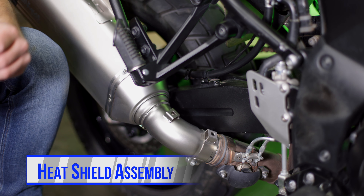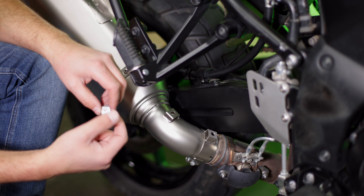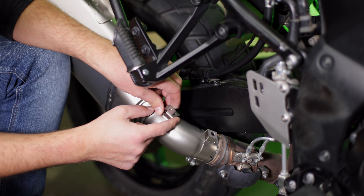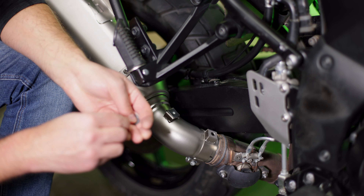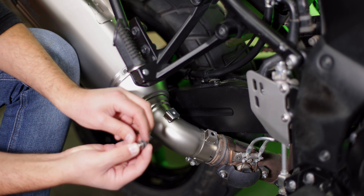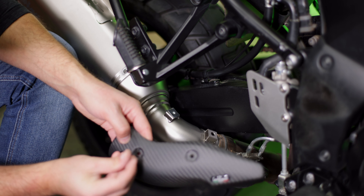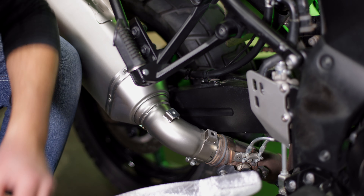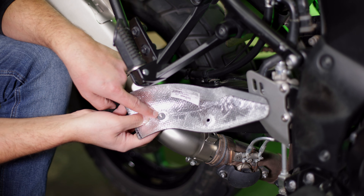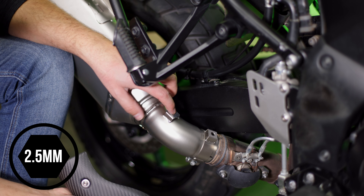If you're watching this and you own a 2020 Suzuki 1050, here's how to mount the heat shield. Place the little nut attachment on the welded bracket. The allen bolt goes in next, followed by the metal washer, and then the carbon washer — thread that on carefully and place it on the heat shield. On the back of the heat shield, take the second carbon washer and thread that onto the bolt. This creates a separation between the heat shield and the metal clip. Line everything up and tighten the bolt onto the clip that has the nut on the back.